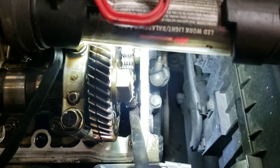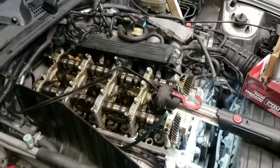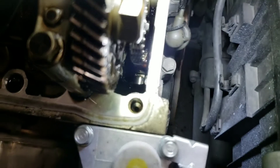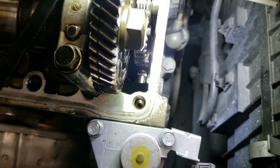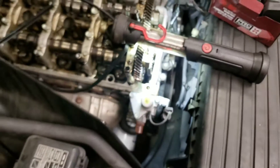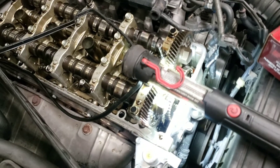I'm going to have to replace that. Sorry I didn't get a video of the noise of it clacking before tearing this apart — I wanted to make sure that this was the issue. That is confirmed. The timing chain tensioner on this S2000 motor — this is an F20, a 2001 S2000 motor — needs replacing. It's clacking like crazy, so we're going to order one up and replace it.